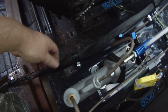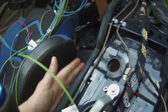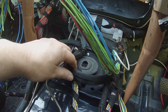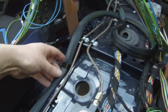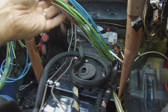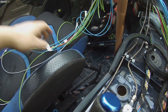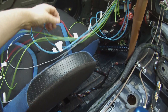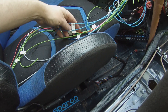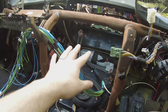This is the wiring harness that comes from the inverter all the way up to the front of the car. I left plenty of slack in it and I've got it all in this nice nylon webbing, a kind of harness cover. We have all of our wires here, all individually labeled. We've used a simple color code: red is 12 volts, black is ground, gray is CAN bus, blue are outputs, and green are inputs. They're all labeled up and brought up to this central point here.